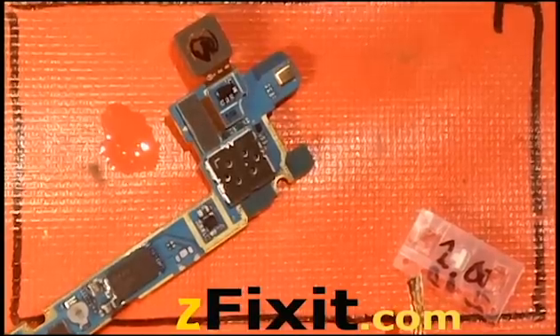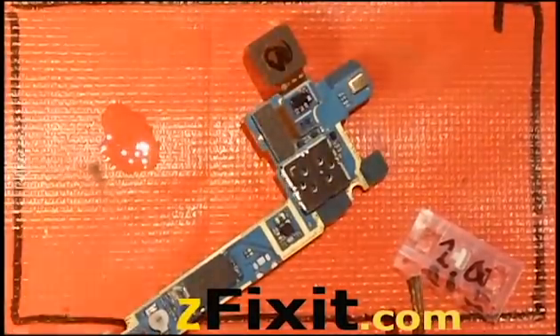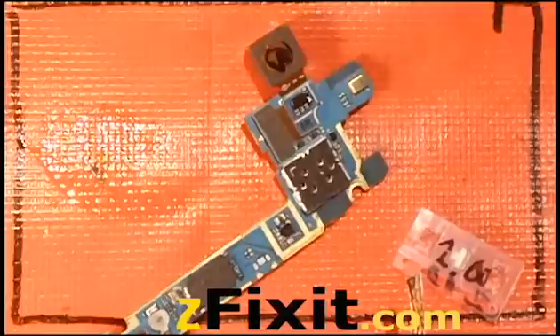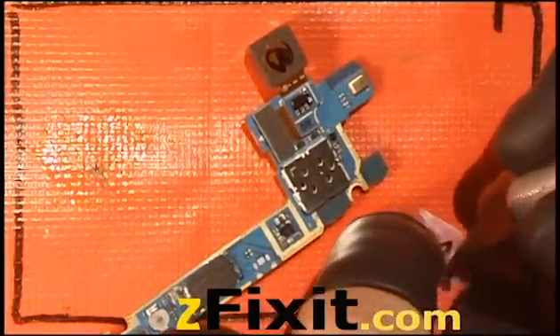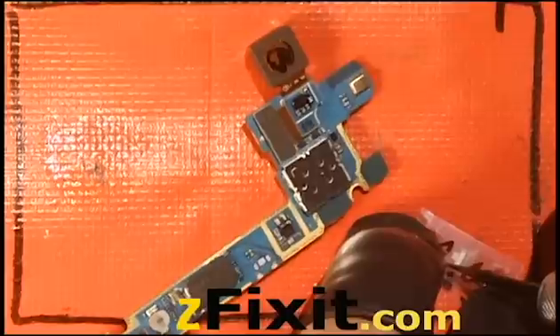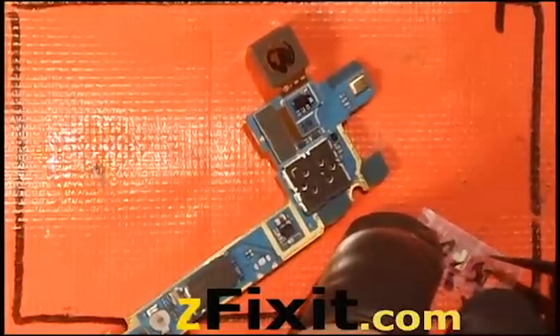Here I'm just going to test fit, making sure that the switch's two hole anchor points actually go into those holes and they're not sticking up too high. Just want to get that as flat as possible onto the logic board — otherwise you're going to have problems when you press the switch and it's not going to catch.